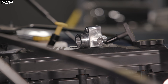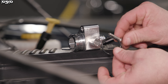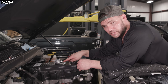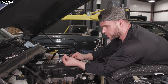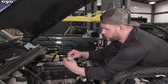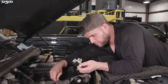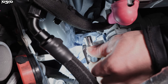Now we need to grab our coolant riser and attach these fittings. We removed our factory coolant riser; that's where our billet coolant riser reroute comes into play. It's got a fitting for coolant to go back to the block and a fitting for coolant to come in. We need to put on our O-ring and then grab our Allen head bolt. On the back side there's a groove where the O-ring fits nice and flush — put a little silicone on there so it goes into the block easy. Gently press it into the block.